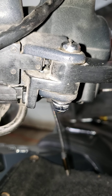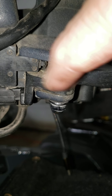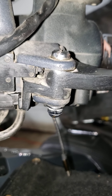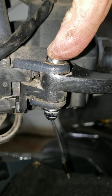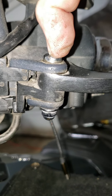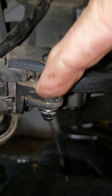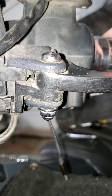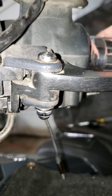I know they talked about it online — you could adhere a shim in there to take up that slack. But really, this bushing is shot and should get replaced. I don't need the bolt, which is $5 some odd cents. I need that bushing that's in there — that's $8. So I'm going to order the bushing and see how it comes out. I think that's going to fix my problem.